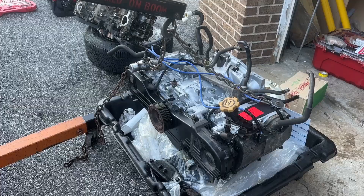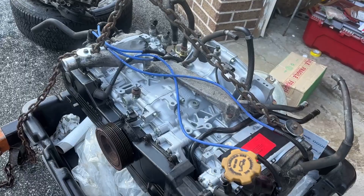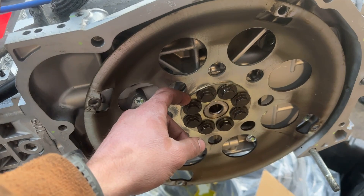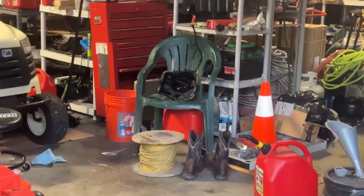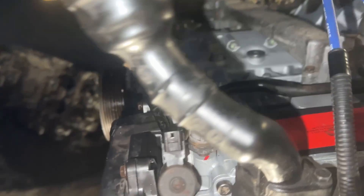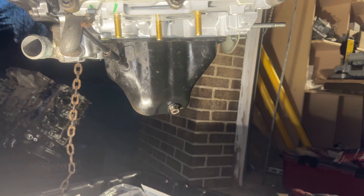We're getting the old engine lifted up. We've secured the flex plate — all eight bolts torqued down to 75 foot pounds with a washer on the outside. Now going to the bottom to put on the oil pan. It has gotten dark again, but we got the oil pan on, screwed and bolted down. I don't know the exact torque spec for the oil pan, but it's on pretty tight — I don't want to strip it since it's aluminum.